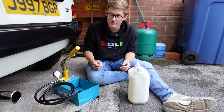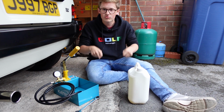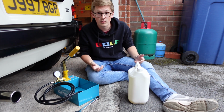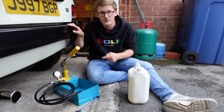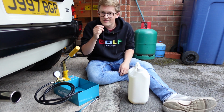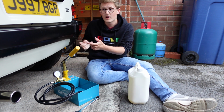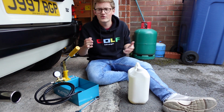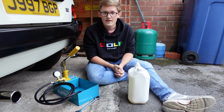I'm completely oversimplifying this, but you want to pull the car backwards and forwards and shake it and rock it up and down so that the suspension rises up and wakes up, or you could just go out for a couple of miles drive. But I've just done that to this car, and when I went back around to the front end after I'd done it from the back, you can see the front end sits considerably higher. And you need to do that to make sure that the ride height is correct once you've finished, because a number of people pump up their cars and then take them out for a drive and they come back and they're sat up in the gods. The wheel arch gap is almost as big as the road wheel itself, which is a bit ridiculous.